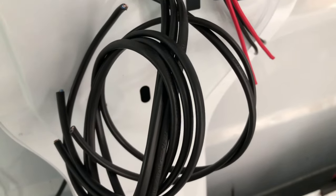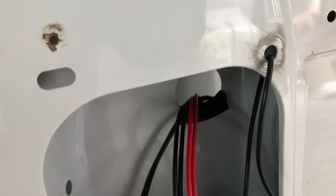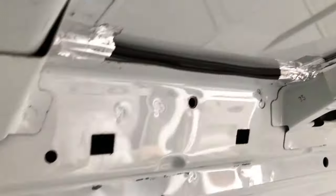One core will go to the switch and the other one will go to the earth. Again, I've rubbed down this area for an earth connection, and then you put a bus bar here and that will be sorted out as well. So those are the cables — I hope that explains everything.